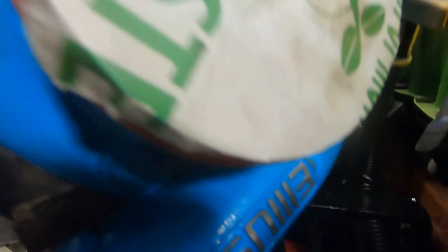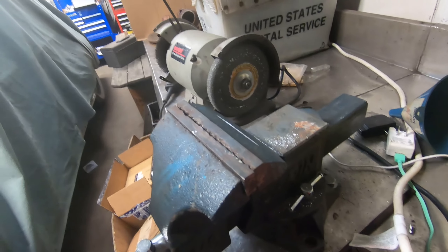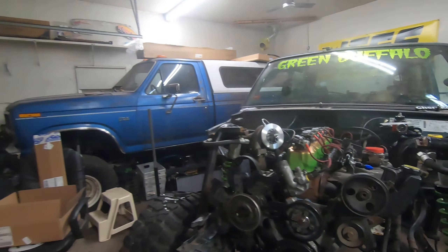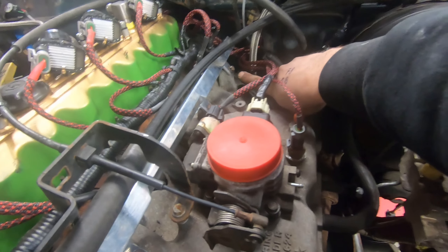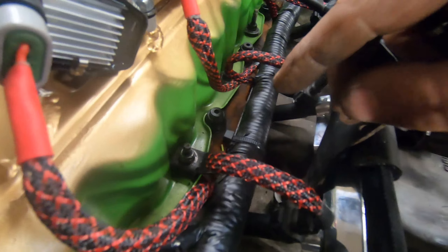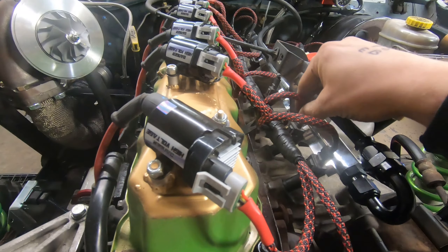He also did a little cleanup on the oil feed line that rubs up against the bracket for the exhaust — we don't think that's going to be a problem, but we just got to keep an eye on the oil drain as well. After trying to make some brackets and bend them in the vise without being able to heat them up correctly, we decided to go scavenging and found some good old Cherokee parts. These brackets came off the stock fuel rail and were holding O2 sensor plugs. We took them off our spare Cherokee and used them to space up the wiring harness for the ignition coils and injectors.